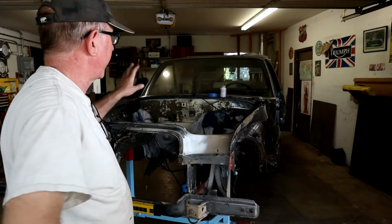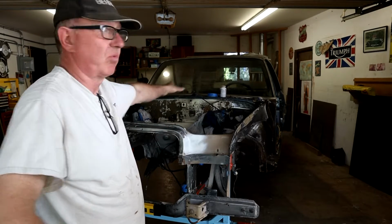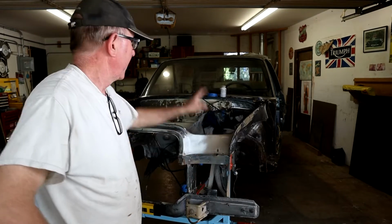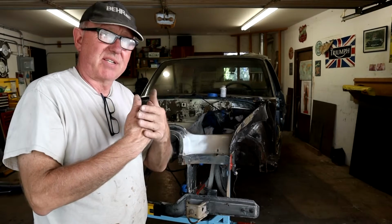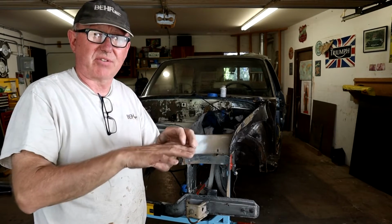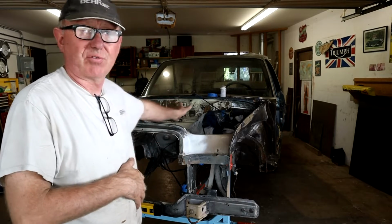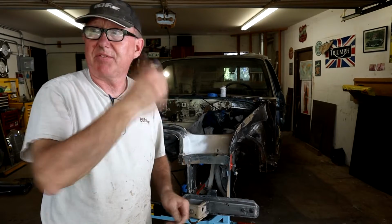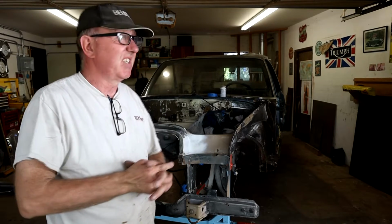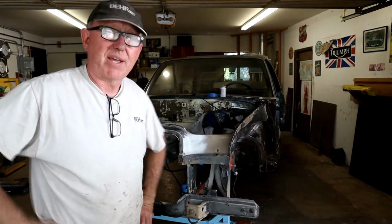Just like I say, take that off, check the channels, check the drainage areas. You certainly don't want water going inside that fan motor, because that causes a nightmare. Plus also those lap joints under there, moisture sits there, it's going to create rust and then eventually rust out. So get that drainage hole clear of all debris and pine needles, and you should be good to go. Maybe even treat it with a bit of Permatex, seal it up, paint it, whatever, and then get some new cabin filters on there.